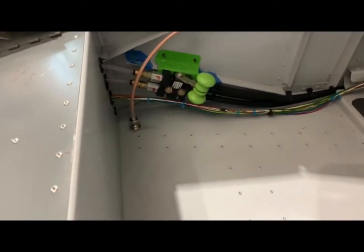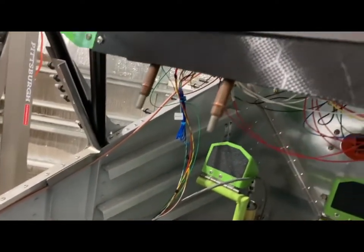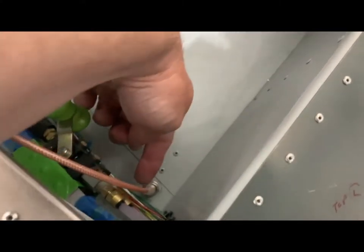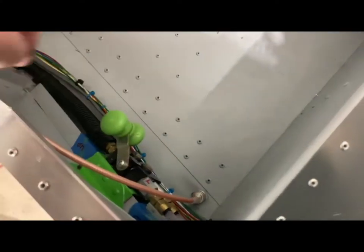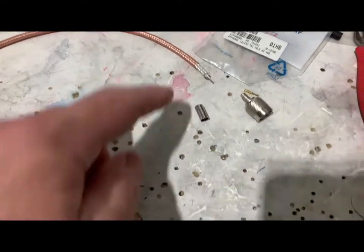You can see where I mounted the antenna for the ADS-B - right there. I'm going to make that look prettier around that whole area. I know it gets a little congested around my parking brake, but you can kind of see it routed up in there, just loosely rigged up for now. I thought about putting a little angle on there instead of coming straight down, but then I'd have to bend the coax more than I wanted to. The bends on this are very subtle - I don't want any sharp bends on it.